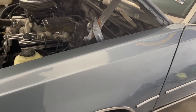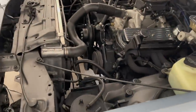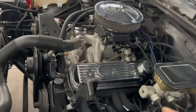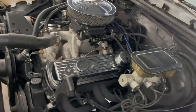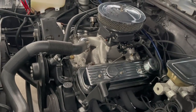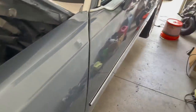Like, what it was, the cruise control. We figured that out here in your garage, I thought. Yeah, that. I came over there and I hit the brakes and the fans cut off. So every time he would hit his brakes, his fans would turn off because somebody ran his fans to his cruise control, which I don't really think is wrong with that, but what we had to do was, because it's getting power with the ignition and he's not going to use his cruise control, bypass the switch. I wish I had that on video when we did that.